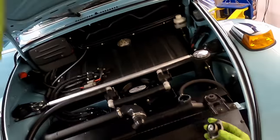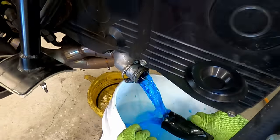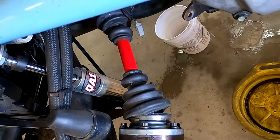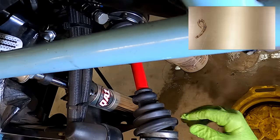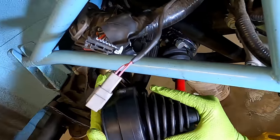Take off the radiator cap and drain the coolant at this location. I use factory OEM coolant and it takes about two and a half gallons. I'm going to try a different kind of CV boot — the CVs hold up fine at this angle but I haven't found the right boot solution yet. The boots need all of their flexibility right where it meets the CV.